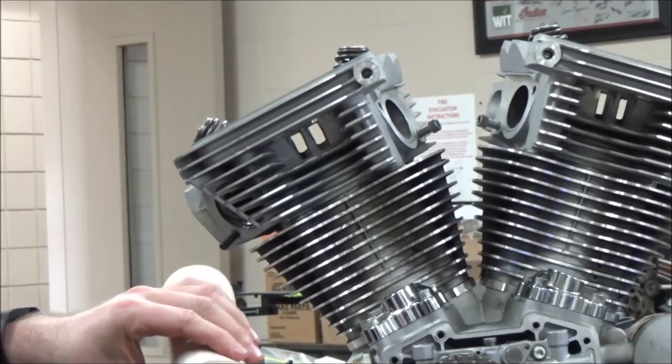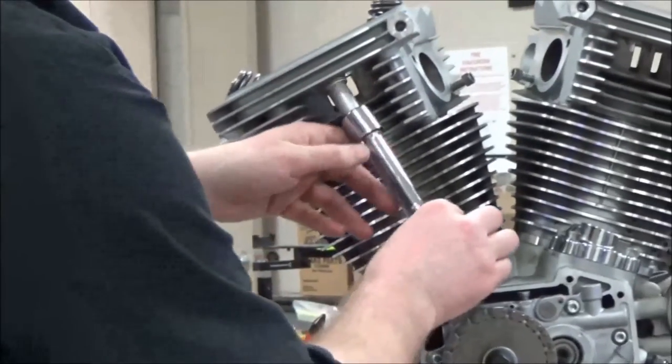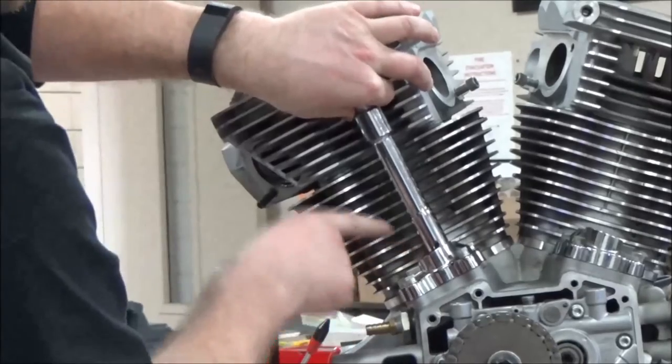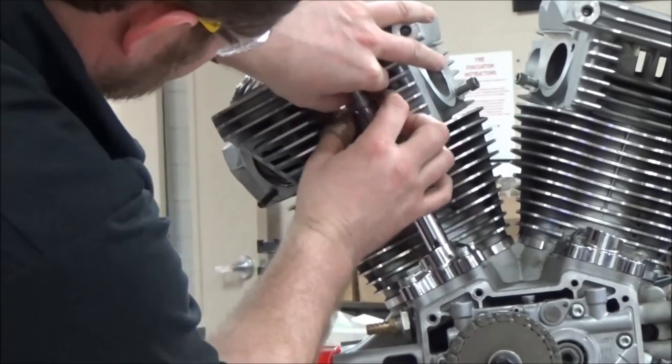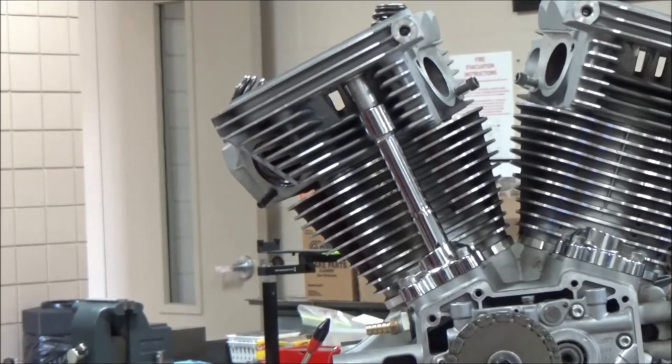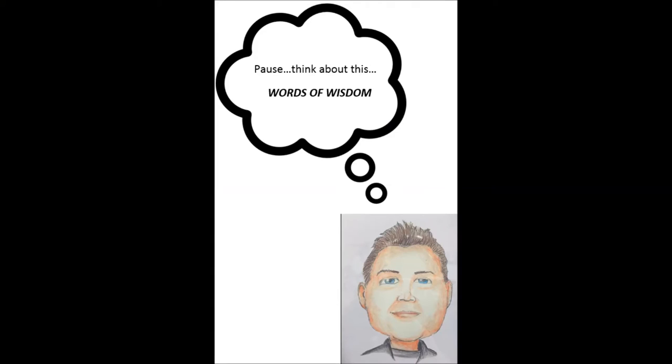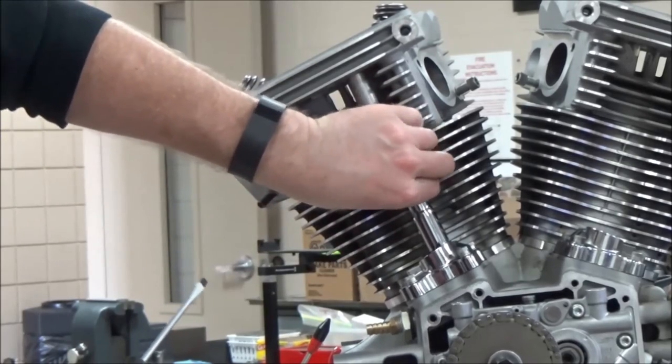We're going to install our push rod tubes. We definitely want some oil on these o-rings. I'm going to go ahead and seat it — you probably couldn't hear that, but it popped. I take a straight blade screwdriver and it pops into place. We really want to put o-rings in wet, or lubricate them. That's an overlooked item for entry-level technicians who dry-fit so many things. When those o-rings are lubricated, the tube rotates nice and easy, and lubrication prevents tearing or damaging the part during install. Before I put my clip in, I like to just rotate it — it's as free as can be.